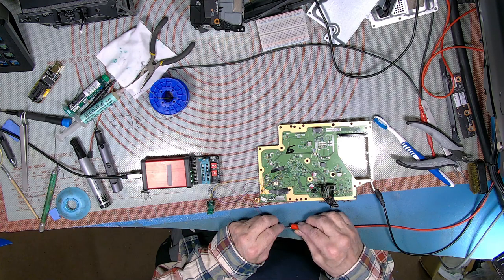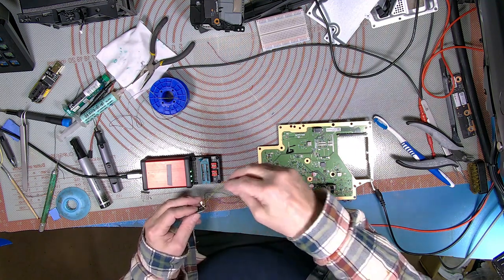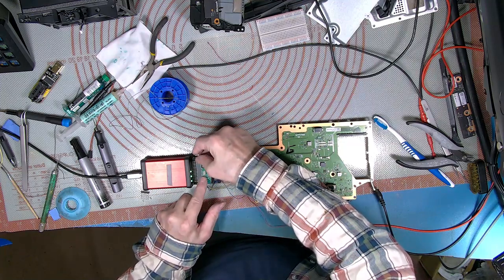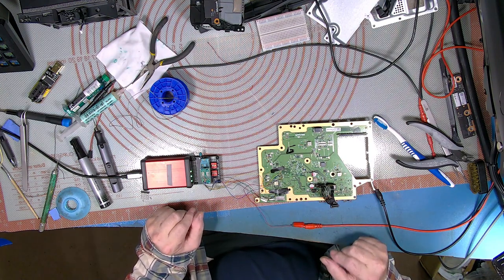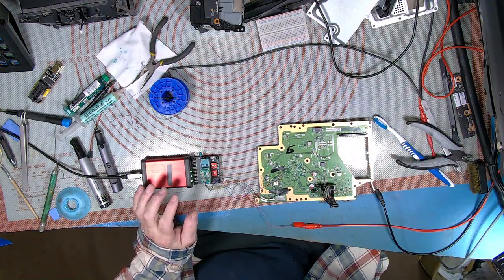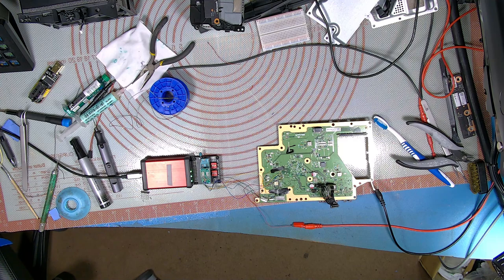Although if you're changing a board to repair a machine, this is a different thing. Right, okay, so let's get this hooked up. What we're going to do, we've got to wipe that NOR first and then put J's version of the NOR in. Right, so I'm going to power it up. So we've got 2 volts, which is drawing 2.7 milliamps. So that sounds about right. So we're now going to go back to the software, if I can find it.